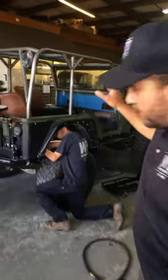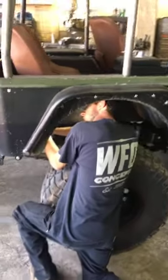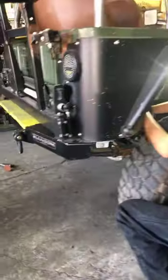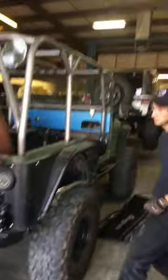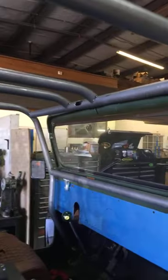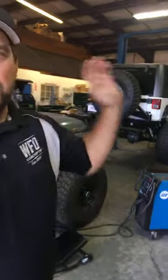Mitch is right here — he's building the roll cage for this really clean CJ5. As you can see, he's tying it into the frame right now. Whenever you do a roll cage it's always a good idea to tie it into the frame. He's also going to add an overhead console — if you zoom in up here you can see the tube is notched out so we can get wiring up there as he starts to build the console.